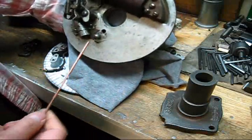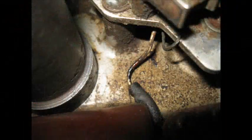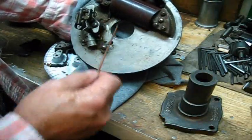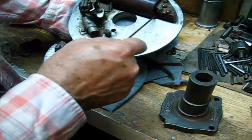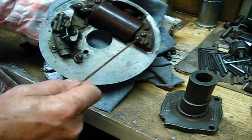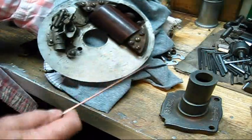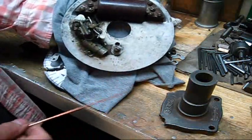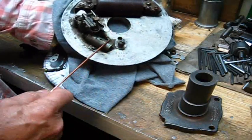Probably the downfall of this system right here was that the covering got off of that wire and I think it grounded out right there. I would say that was the only thing wrong with this ignition system. This wire does have to be covered and isolated electrically. The ground wire comes out on that side over there and comes around and underneath that head on that bolt right there — it just makes a loop, a circuit. It's a simple high tension coil and we are going to do the ohms on it.